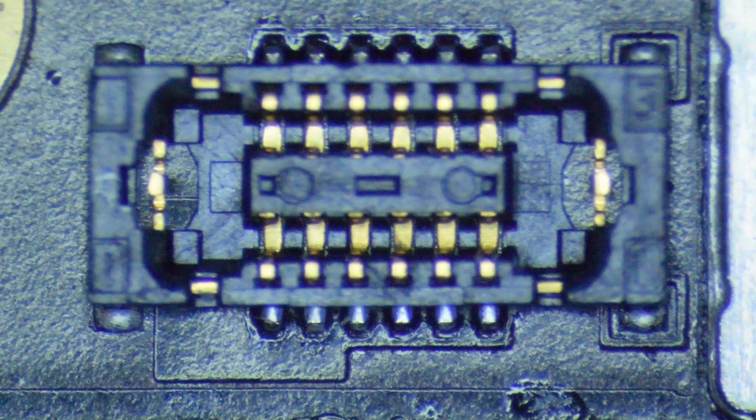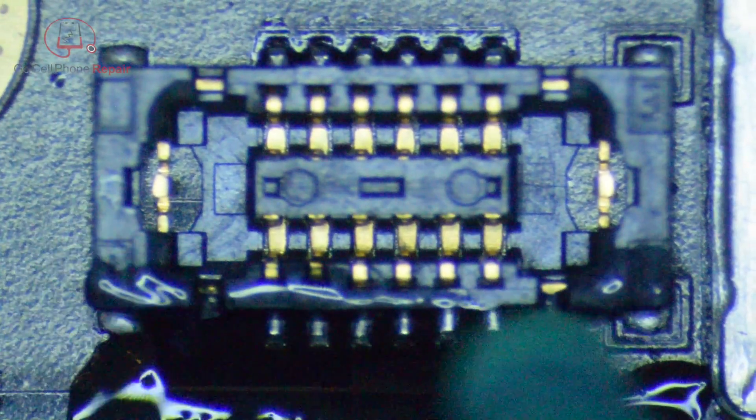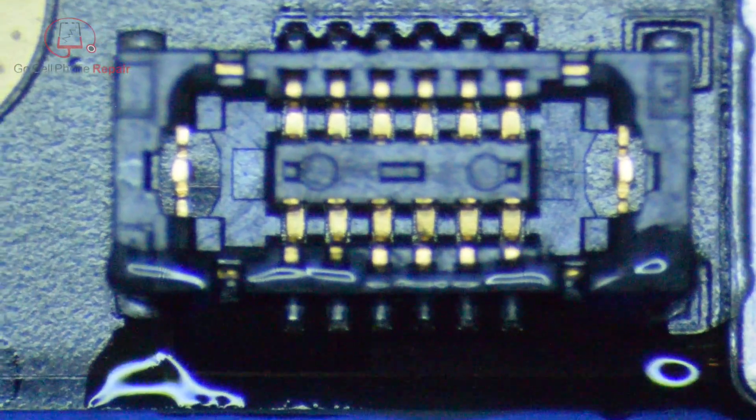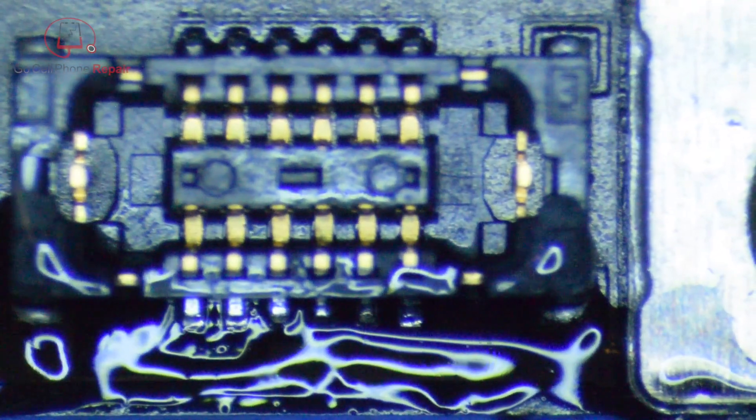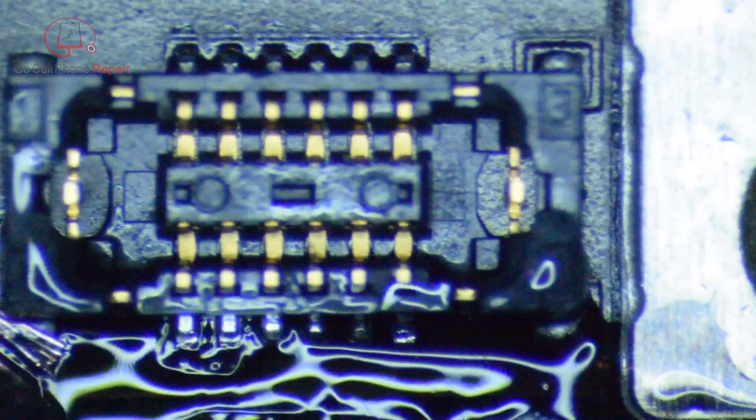So I'm going to start with my donor board here. I didn't have an extra connector on hand, but I did have a healthy looking one on another iPhone 6 that does not work — I've already pulled quite a few parts off of it. I'm going to put some flux down here. I was really more interested to see how difficult it was going to be to get this off as is. Here you can see I'm going to go and wick away some of the existing solder. This stuff came off pretty easily because you've got quite a bit of surface area you can access here, as opposed to when you're working on very small components in very tight spaces.